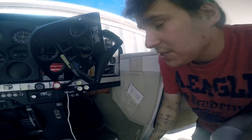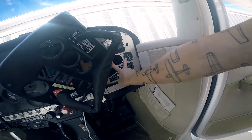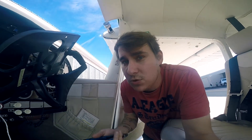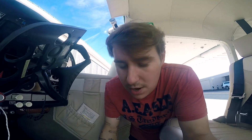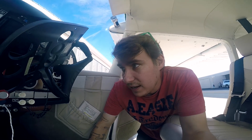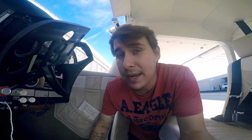The first thing I'm actually going to do is activate the Hobbs meters on it — the Hobbs meters are right there. I'm activating those because for the first 25 hours of flight, it wasn't being used for hire. It was just the owners breaking everything in. But now that it's broken in, they're going to be renting out this aircraft, so we need a Hobbs meter for time so they can bill them. They're also going to run a maintenance Hobbs to track the maintenance on the engine, because they're not sure how accurate the tach is with how old it is.